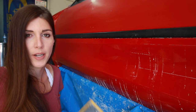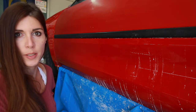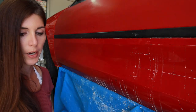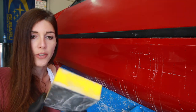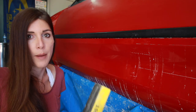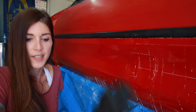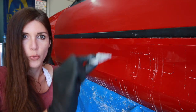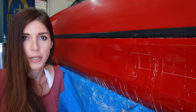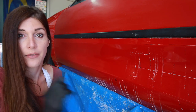I did make a video on this wet sanding process about 9 or 10 months ago, but I'm going to explain real quick what I'm doing. Basically, I'm going over with water in this spray bottle using this foam block — it's 1500 grit. This is actually the first time I've tried a foam block; usually I just take a piece of plexiglass and wrap my 1500 grit around that so it can flex and contour. After I start sanding, I squeegee the clear coat and gunk off, then wipe it dry with a microfiber so I can see how much orange peel is left.